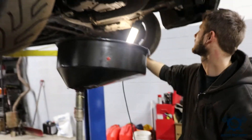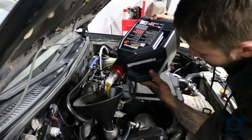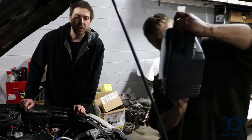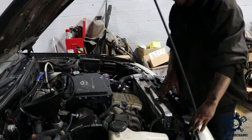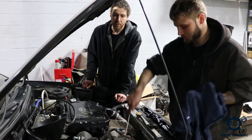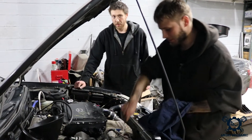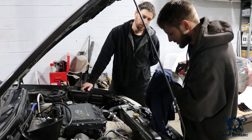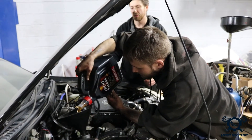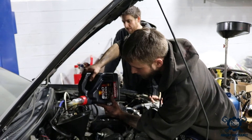Now we can lower the vehicle. It's time to fill the oil — grab our funnel, stick it in. Hey, how much are you pouring in there? It's not a Mustang, you know — it'll take six liters. Don't pour all your oil in at once — it's a good idea to check the level. If you overfill it, you can cause issues with the engine including damage — you blow out seals. And if you overfilled it, you've gotta drain it again, and nobody wants to do that. We're about halfway up the stick — fill a little more, about another liter or so. Don't forget the oil filter is gonna take a little bit of oil. After you start the car, the oil level will go down, so it's a good idea to double check it after you start it, then top up when you're done.